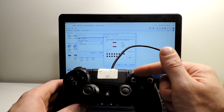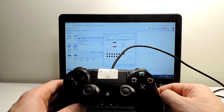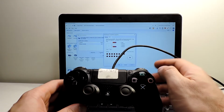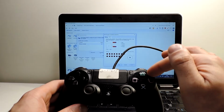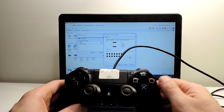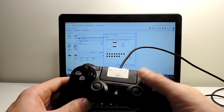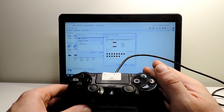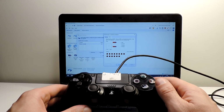So that's why when we opened it, in this case, we could see that there was some dried liquid stuck there, let's say. After it dries, it gets sticky and sticks to the socket, to the button, and to the plastic, as you saw when we pressed the button against the board. So for now, this is it. Hope this video helped someone. I would suggest always to disassemble just to be sure that everything is cleaned, but if you don't want to disassemble and soaking it solves the issue, then it should be fine.